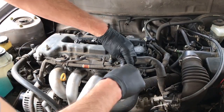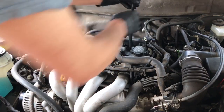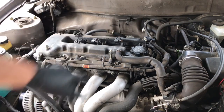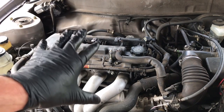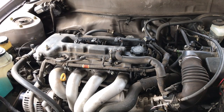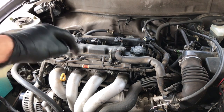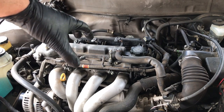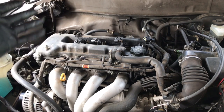So what does it mean when your engine is at operating temperature and all your cylinder compression is balanced, but yet when it's cold, you have two really low cylinders? I was gonna do a wet compression test. So you add like a tablespoon of oil, and that, if it's a piston ring problem, will create a temporary seal around the ring or in the bore, and the compression should come up.